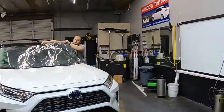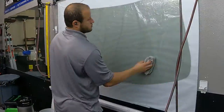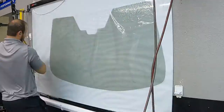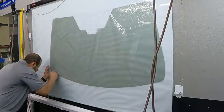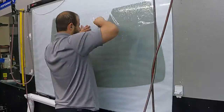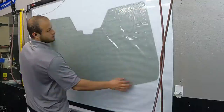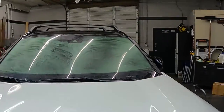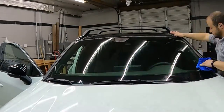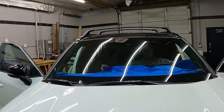We got the film all shrunk — we're going to pull it up on the glass, weed it out, and trim back the corners a little bit all the way around the film because we are doing reverse roll. I find it a lot easier if the film's not overlapping everywhere. You want a tight bottom — the top not so much — but the less you have around your cut on the bottom and sides, the easier it is to reverse roll it across the windshield.